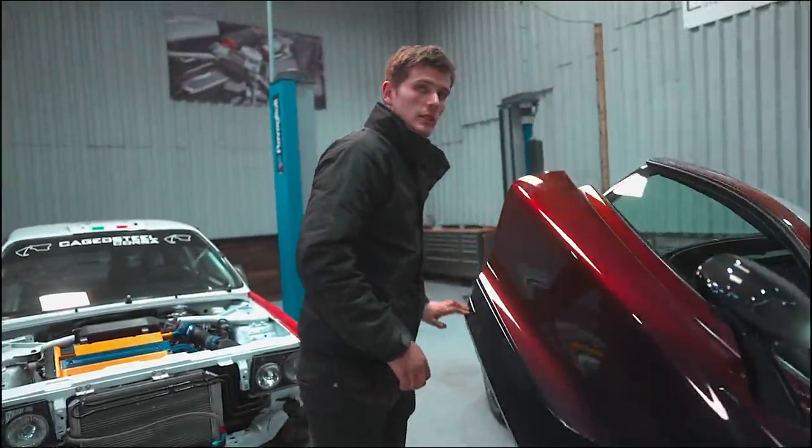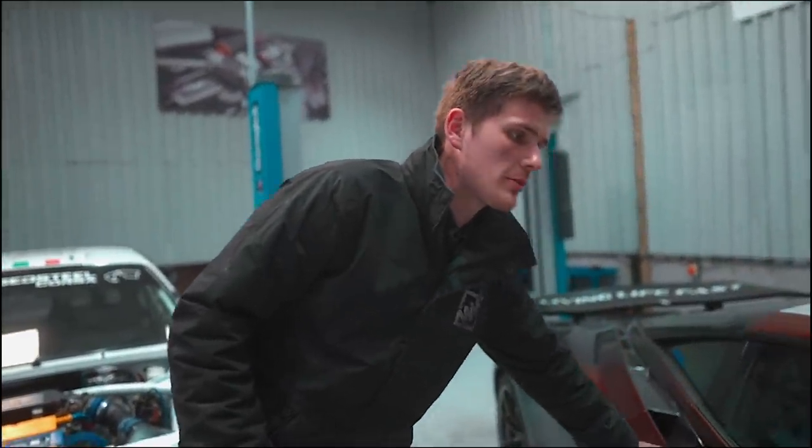So if I'm pushing it now, will it go into oversteer or no? It'd be pretty neutral. It's almost like a wash, the whole car sort of washes now. Okay. And that's what these settings do to it. When you go to track, you start getting the oversteer. Yeah. And that sort of brings the back end to life as well. So the car's all back together? Yeah, all sorted. Camber shims in, geometry, camber and toe all sorted now. So take it for a spin and see what you think.